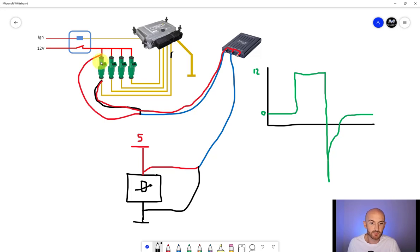That injector is going to be powered on constantly because we've bypassed the switch inside the ECU. The injector should always get its ground through the ECU, but what we've just done is give it a ground through the scope itself. In cases like this, what you'll probably experience is the engine will start misfiring. In more extreme cases, depending on how much current goes through that circuit, you could also damage the scope. These oscilloscopes don't have big heavy-duty wires — let's go and check it out on the car and see what happens.